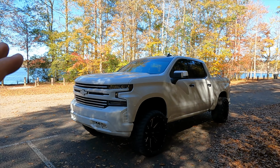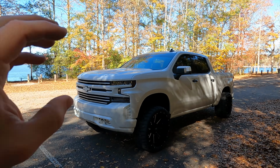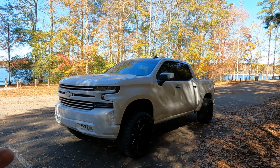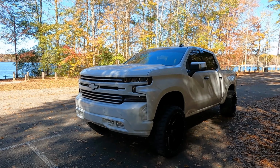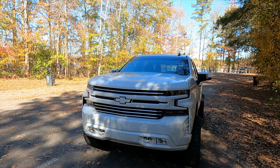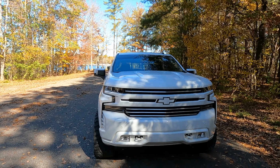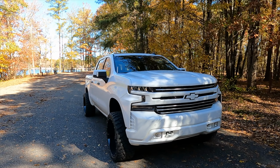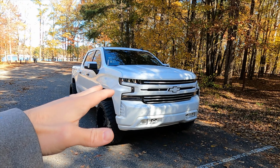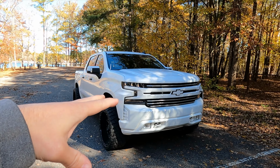And that is why they say no four-wheel auto, because when you're in four-wheel auto, the truck is essentially in two-wheel, but it's prepared to immediately drop it in four-wheel if the tires start spinning, which I've never personally had a need for. I saw on the Trail Boss page, some people like driving in it with heavy rain, obviously in the snow. I don't know why you wouldn't just put it in four-wheel drive high and just run it. That's what I would do if I was driving everywhere in the snow, because when you're in four-wheel auto, it's essentially locked in but not engaged. So your two-wheel starts spinning, boom, four-wheel drive locks in.